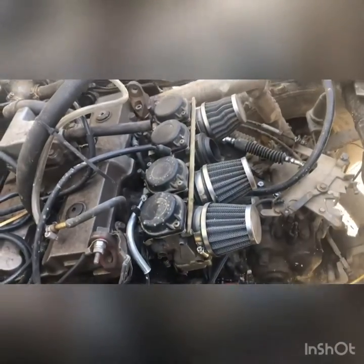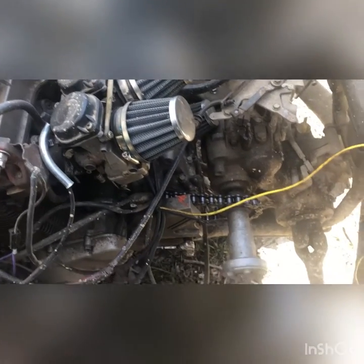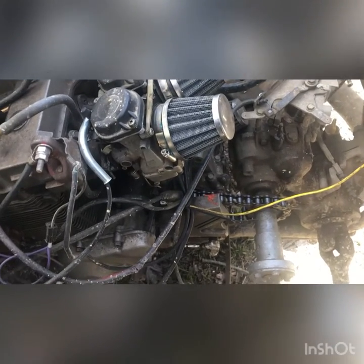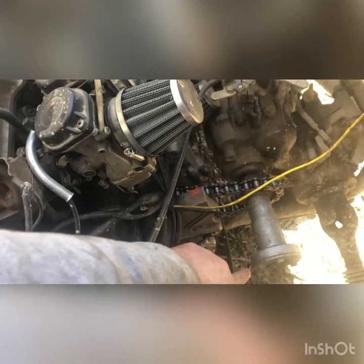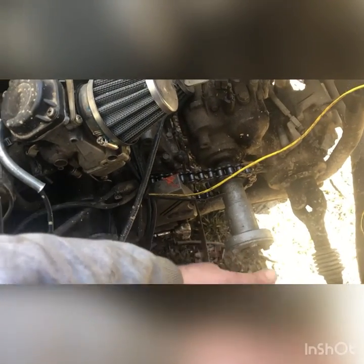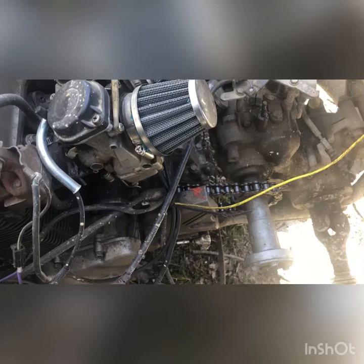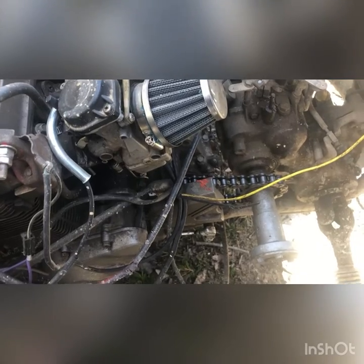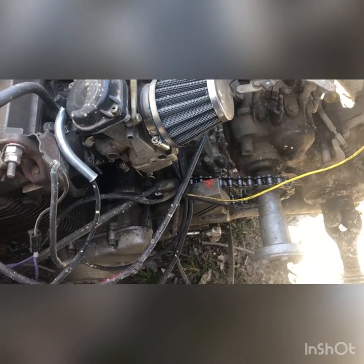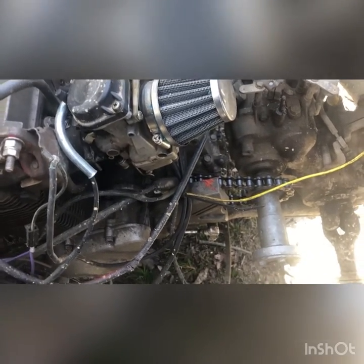So it's missing an air filter. You don't need to worry about it. It's right there. It's probably doing something. The CVT that came on this thing, pretty handy. When Kawasaki designed this thing, they had this threaded insert. You can see these cap screws here are everything. This flange is actually the spline section that goes into the transmission. That's why that thing is so long, is I wanted to preserve that in case I ever wanted to put that CVT back on. But I made this adapter to bolt to that spline section so that I could then weld a sprocket to that adapter and make this thing a 6-speed.